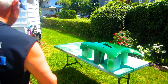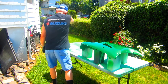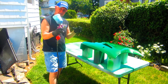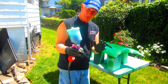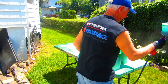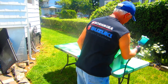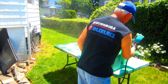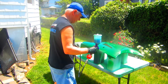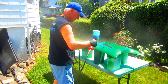You probably couldn't have a better day for painting. I have just ever so lightly sanded the top coat of green — this just slightly changes the color — but I have the original parts to match it to. Once I'm happy that it's matched I'll put some clear on, and if I'm in doubt I'll let Vlad make the decision, because this candy apple paint can really be tricky. It changes the color ever so slightly, but enough that you would notice it.